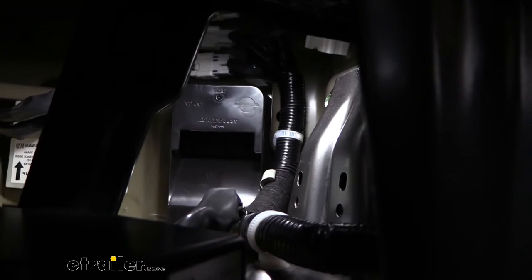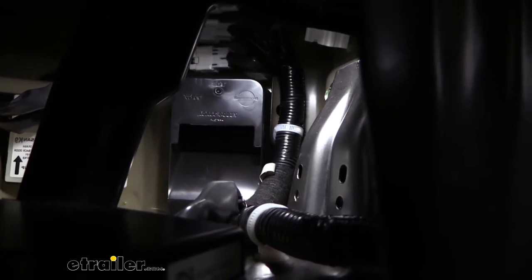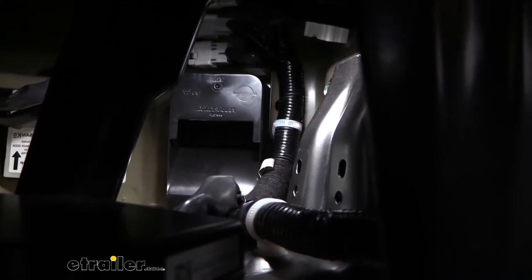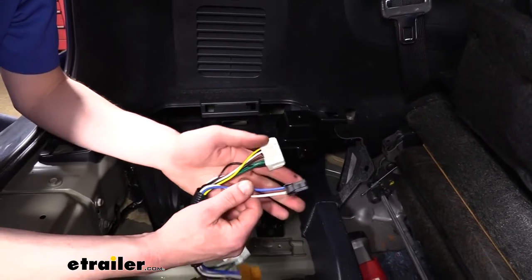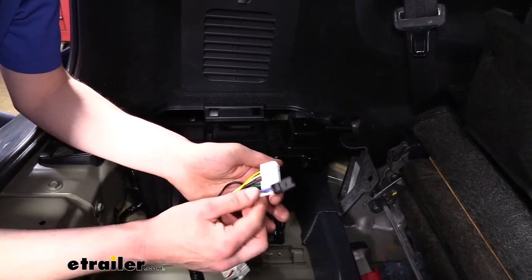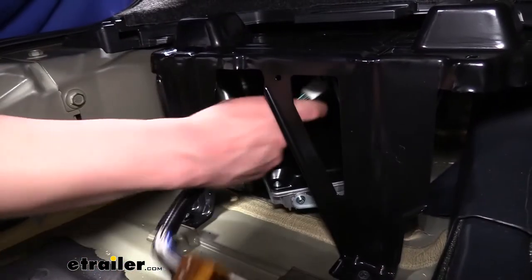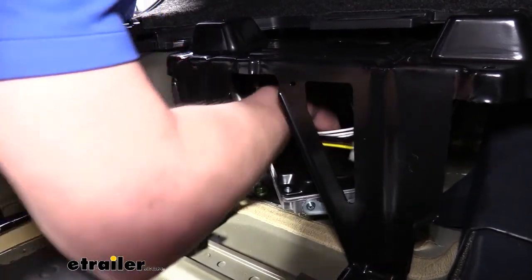Our connector is going to be on the back wall, underneath the metal brace we just removed the carpeted cover from. Reach into the large opening to access it. The two connectors stacked on top of each other towards the right are not the ones we want — we're looking at the connector on the left at the top with the open end facing down towards the ground. On our new harness, there's a large white connector and a small black connector right next to it towards the inside of the vehicle — it's just very difficult to see. We want the release tabs facing towards the outside when we plug them in.